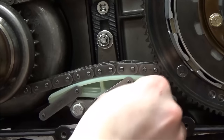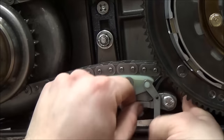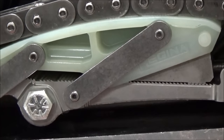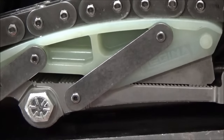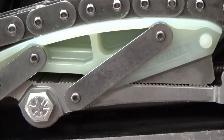Another reason I don't like lock patch is because once you torque a bolt with lock patch, you're not supposed to remove it without applying Loctite. To check and make sure this tensioner is installed properly, you need to flex the top of the chain. You see how the tensioner is moving up and down? That means it does not need to be taken back off and lowered down any.